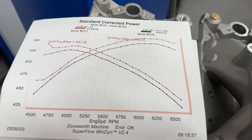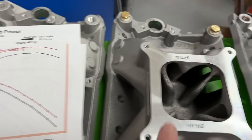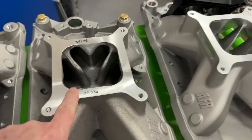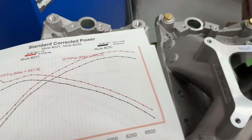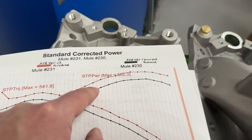This last graph is comparing the cloverleaf-machined-out intake versus the fully ported one on the same day - so I pulled the first run of each. The numbers look really great for the ported one. There's a little torque kick there, but look at this comparison: how much more does the ported intake make versus just having the cloverleaf cut out? It's better everywhere by a significant margin - ignore that little jump, that's just how the dyno loaded. This also makes me think that if I had a stock intake on the same day, the differences would have been even more dramatic.